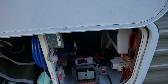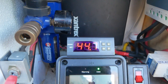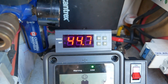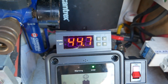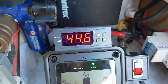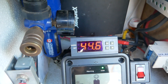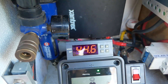The first thing I did was order a temperature control unit from Amazon. It's a whopping $17 for this device and it can be set so that it turns on a 12-volt circuit at whatever temperature you want, and then turns it off at whatever temperature you want. As you can see, it's 44.7 degrees Fahrenheit right now in the battery box — not here where the controller is. There's a wire that runs over to the battery box with a thermostat probe.